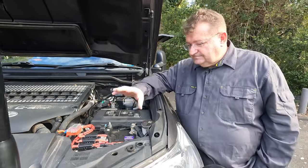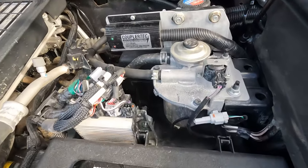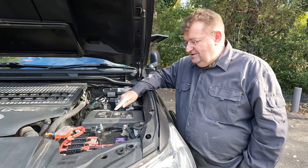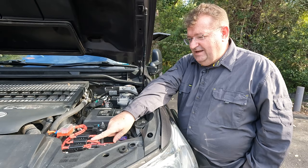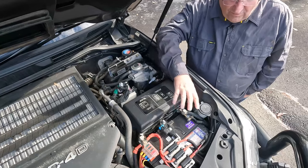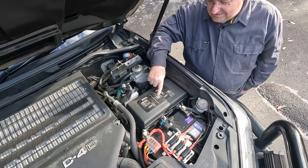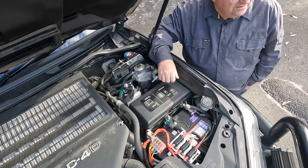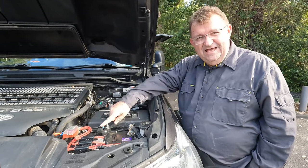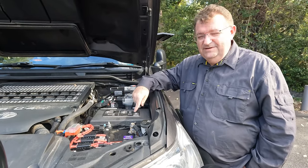There's just one battery under the bonnet — all the 200 series needs to get going. Importantly, all the extras have been documented and a plate added to the top of the relay box showing what each fuse covers — Redarc, Redarc, front DC-DC, side spots, spotlights, brake controller. Very easy to follow. When you're out in the desert trying to solve something that's gone wrong, a couple of years after the work was done, little things like labeled fuses make a really big difference.